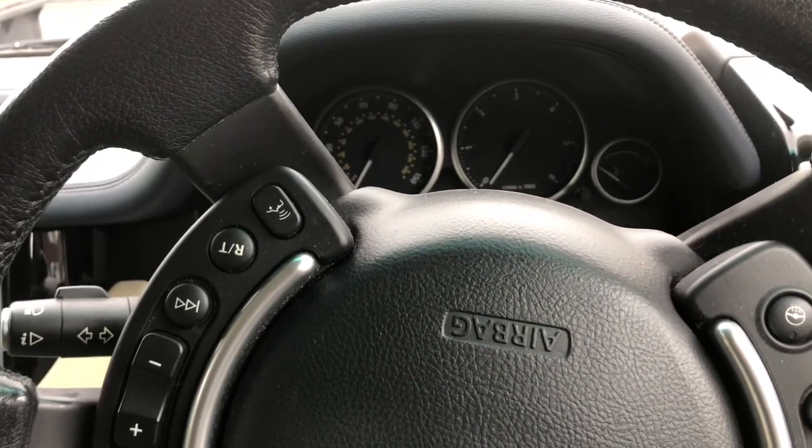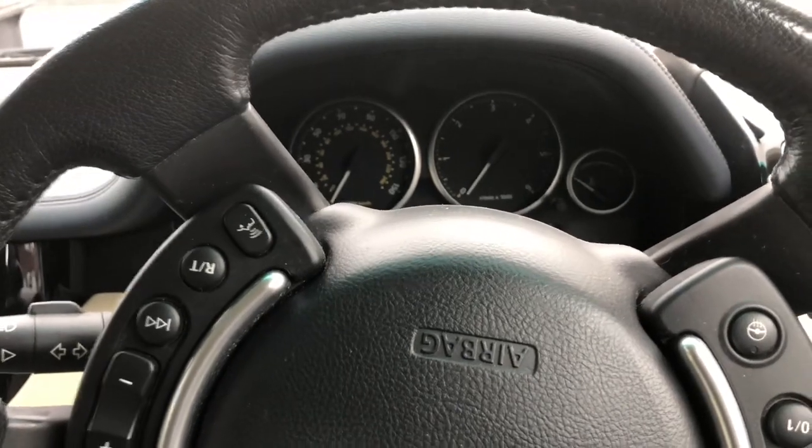Then you can create a bit of an internal scorecard on how you're going to value this vehicle. Is it worth what they're asking for it? It doesn't hurt to walk away from a potential sale — if only to give the seller time to reflect on how interested you were. You might want to go to a cafe around the corner, have a coffee and have a little think. You might have travelled some distance to look at this car. Always mention the tyres, the condition. Does it need any servicing jobs coming up? Did you identify anything when looking around that needs doing? Have you spotted an oil leak? It might not be serious, but it might be something to use as a bargaining tool — a bit of leverage to get a few quid knocked off.